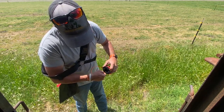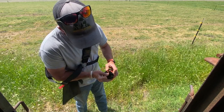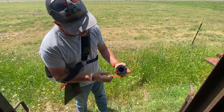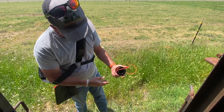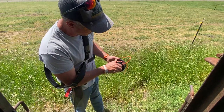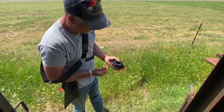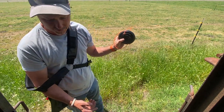There are places you can click the string into, and it will hold it until you're ready to use it and put it into the head itself. On this string trimmer head there are actually two different size holes on it. But that's all there is to it. After I did that I didn't have any more issues. After you put it in the head, you can just snap it out, put it in the holes of the string trimmer head, and put it back on your machine, and you should be good to go.